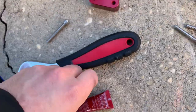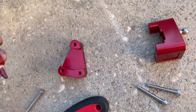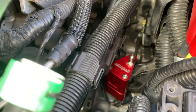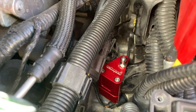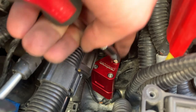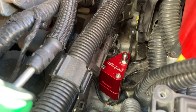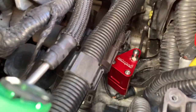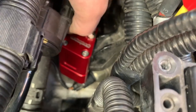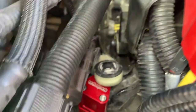Remember, Loctite these — all three, all four if you're counting the ball. I didn't realize how tight it was, but to get all those bolts tight back there in this tiny little space was super hard. People online on these other DIY installs make it look easy, but getting these in there — there's hardly any clearance. I just messed with it for probably a half hour and it's finally on, so good luck. Then you're gonna put the arm back on top of the ball and it'll click into place.